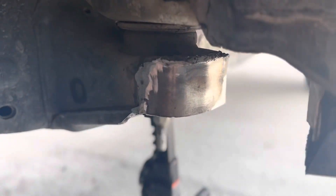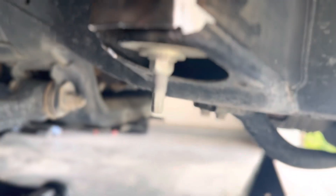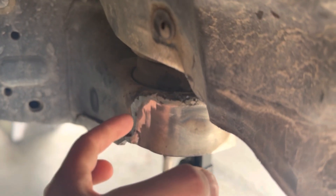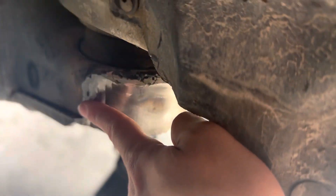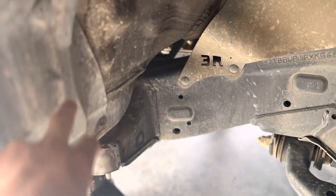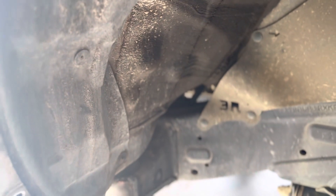Go ahead and show you the driver's side — same thing up top, looks a little rough, but the sides are looking good. Just to give you an idea of the clearance here: this used to stick out probably to at least here, and it was a straight line. Next will be the pinch weld — under here there's a pinch weld. Just cut it and flatten it up to about this point right here. I'll be making a video on that when that time comes.